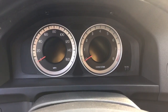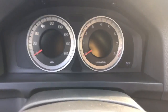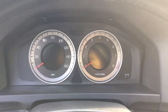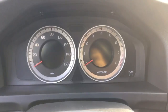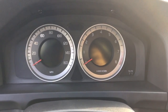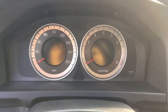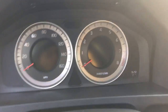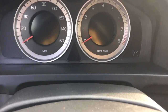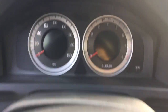I'm going to replace the speedometer on a 2012 Volvo S60 with a new style virtual display. This one is compatible with 2010, 2011, 2012, and 2013 S60, XC60, V70, and S80 models. All we have to do is remove four screws, one cover, and unplug one connector — that's all. Very easy, takes just a few minutes as you will see.